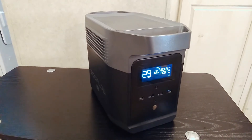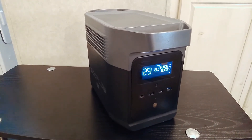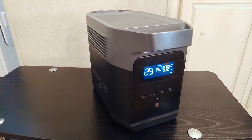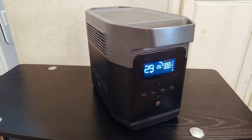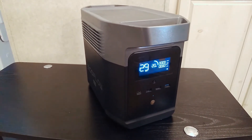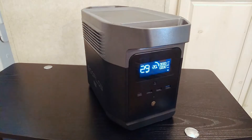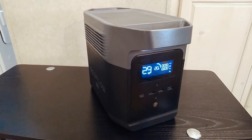This affects the number of life cycles and how long the battery will be able to hold capacity above 80 percent. So this is something you just need to be using. Even if you're the type of person who wants to get the most out of your battery, I would just recommend setting it to 5 percent on the low end and 95 percent on the high end.